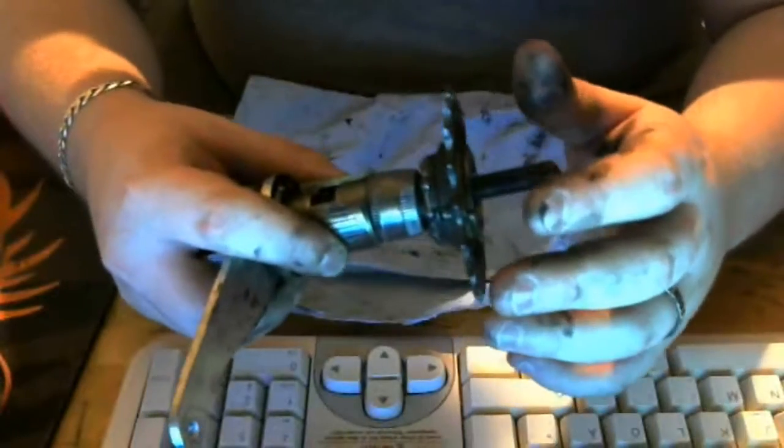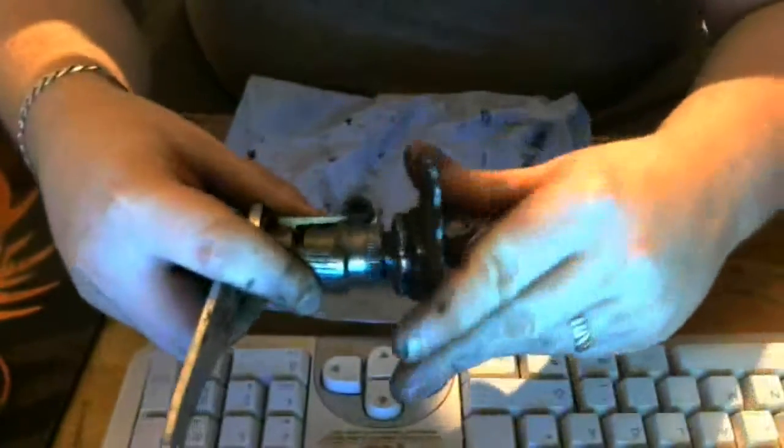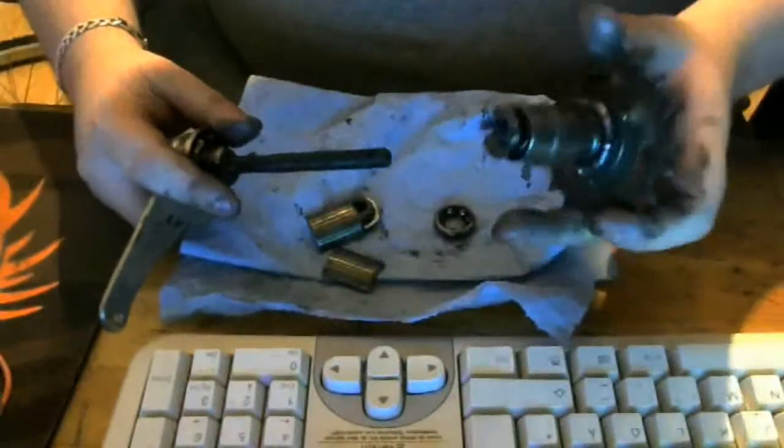Now trust me, these hubs get extremely hot. Just trust me on that. It's so hot it's uncomfortable. That's why I have this kind of grease in mine, and also in one of my friends', because this is high temperature, high pressure graphite grease, or graphite lithium grease, so it can handle this sort of thing. It can handle people that are overweight like me. I don't want the grease being the first thing to give out, which, by the way, it already had when I pulled this thing apart at first.